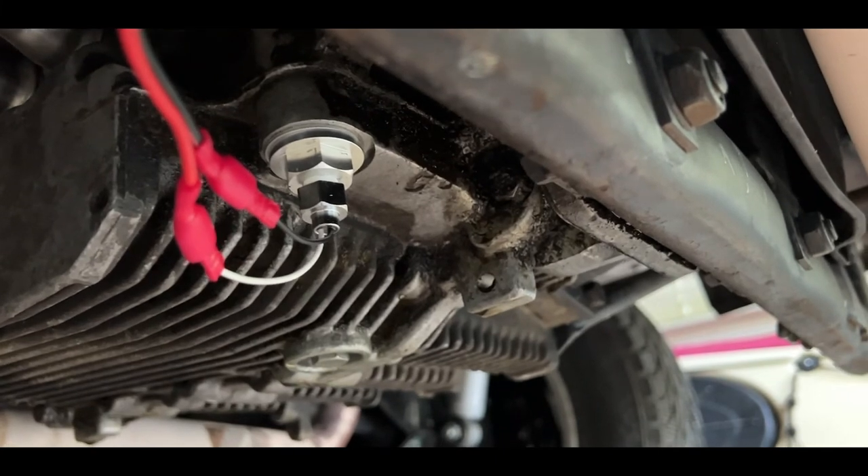With the relocation, I was going to try to put all three sensors on there — low oil pressure, oil temperature, and oil pressure overall. But with the relocation it really does seem like a good idea to have the temperature there since it's so removed. So for the temperature I got from Go Westy their oil pressure relief plug, which comes with its own port so you can put a temperature sender there. From what I've read it's not the optimal place to get temperature, but at least you can get an idea of what's going on there. After that everything was tightened and wrapped up. I've taken it on a couple of test drives and everything seems to be holding out well.